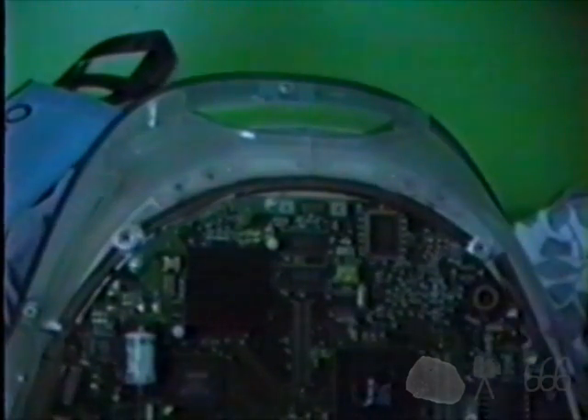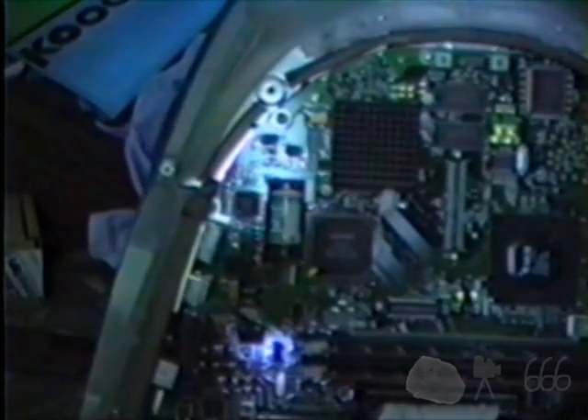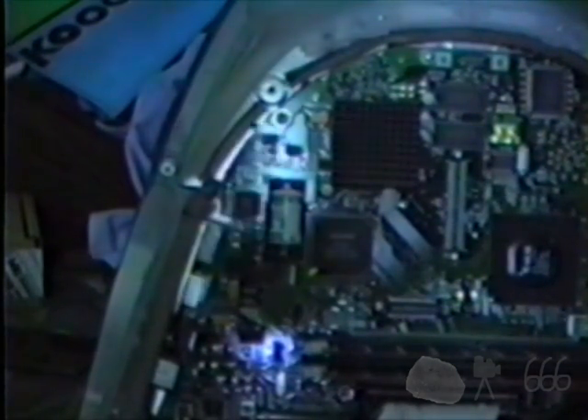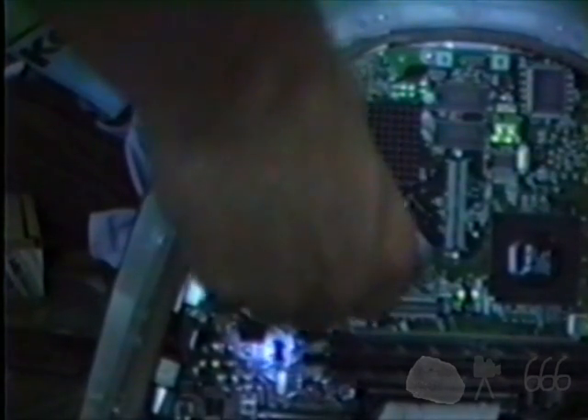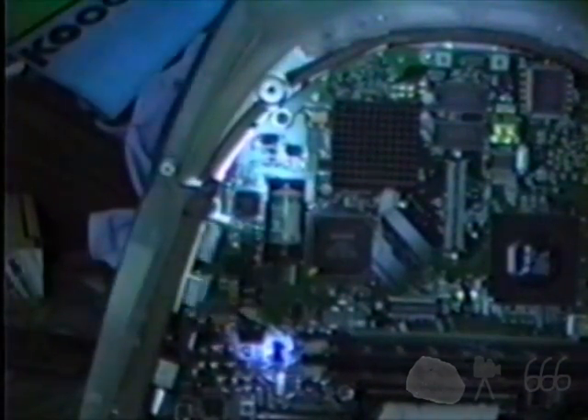Being very gentle with this shield because you could break it, and then you'll really ruin your day because these are expensive — or you could break something that it's attached to. Go ahead and pull the shield out, and we can see what we want to see. There is your battery right there. And one of the things you really want to make sure of is that you remove these batteries when you first get the machines. The reason for this is these are ticking time bombs — they will leak, and in fact they're actually known for exploding, which is very serious.